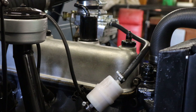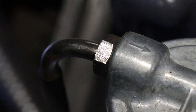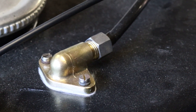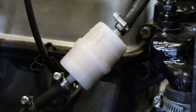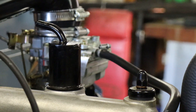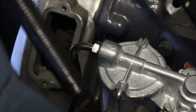The last and final change you'll need to make is to the fuel lines, which is a minor change but they do need to be adapted. The supply pipe from the fuel tank to the mechanical pump, and the pipe from the pump to the carb, is what you need to address. The pipe from a Series 2 will fit, or you can just make up new ones with the correct fittings, which is what I did.